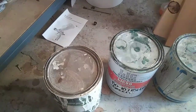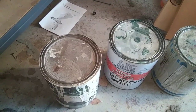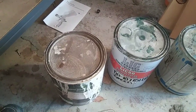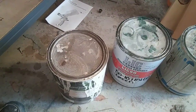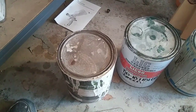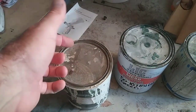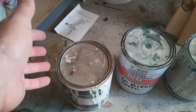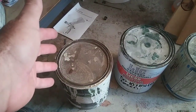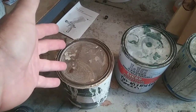They call it zero VOC, but it's not the acetone one. It was about 50 bucks a gallon, and that stuff really was a good reducer — and it was really fast. Generally, remember spraying is about putting thousands of dots onto something. The finer the spray, the less the orange peel, and the less need for a really heavy coat. Having the material thin enough to do the job is the most important thing.